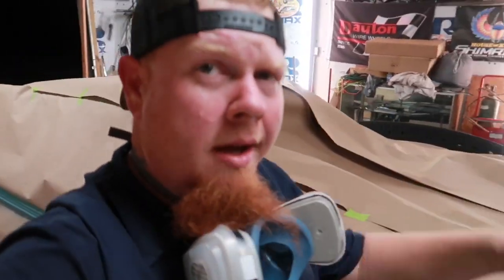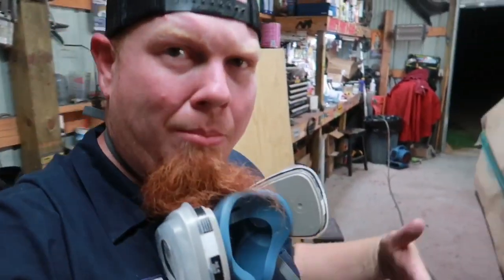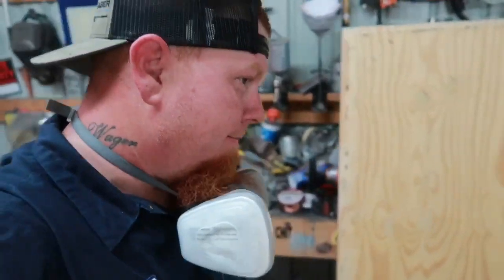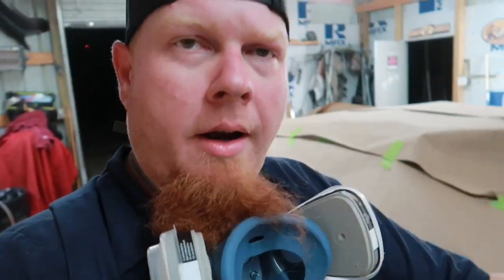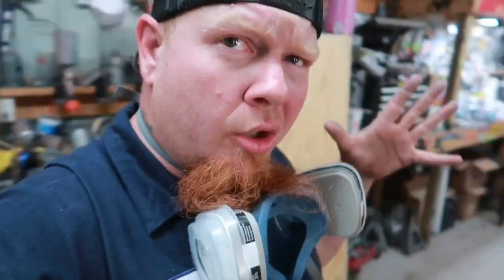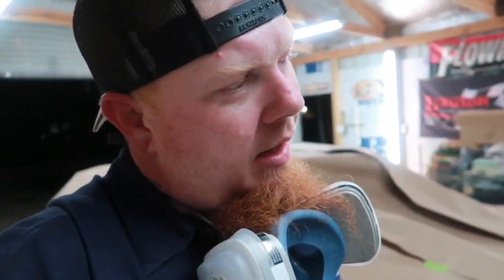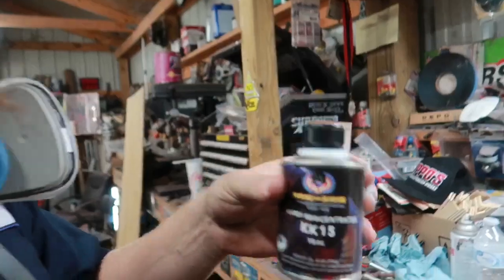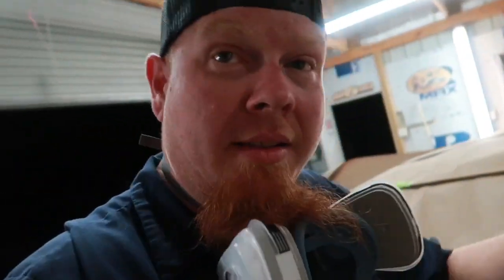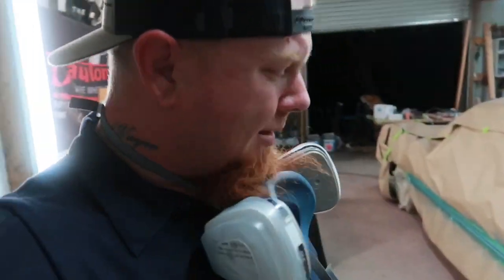I think it's going to be enough. Next stage is laying the candy down. You can't really brush it like I've been doing — candy is transparent, kind of like clear, so you have to do one coat all the way down one side, one coat all the way down the other side, give it some flash time, then come back and do it again. I'm probably going to run two coats of candy and see how that looks, then shoot some clear over it to get it sealed. I like to use House of Color candy — the concentrate. I use the binder instead of intercoat clear, it works pretty good, works like an intercoat, and it's a little bit cheaper than intercoat too.